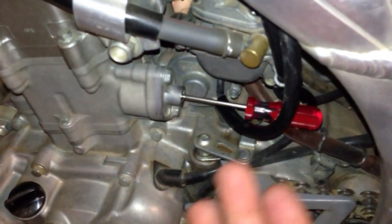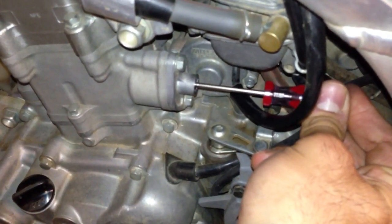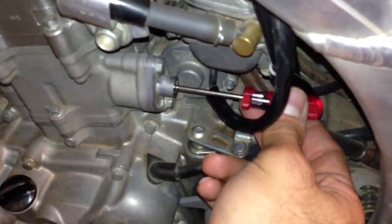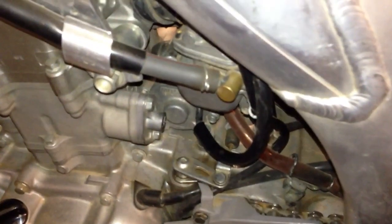You can let it sit here, do your work, and then when you're done, you come in and pull it just a little bit. It lets go and then it'll snap around, spin about two rotations, and the cam chain tensioner re-engages and tightens up the cam chain. Remove your tool, put your bolt back, and you're done.